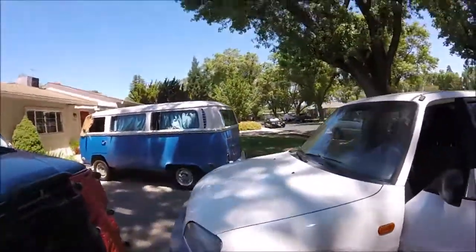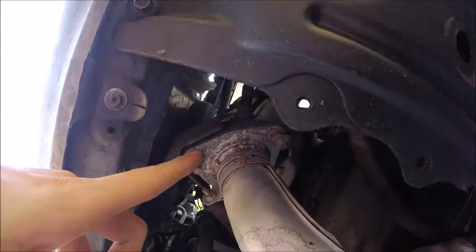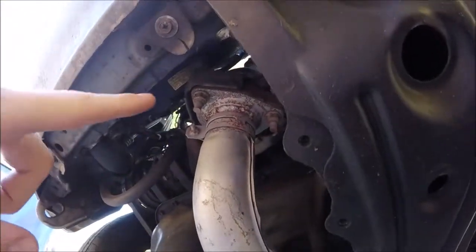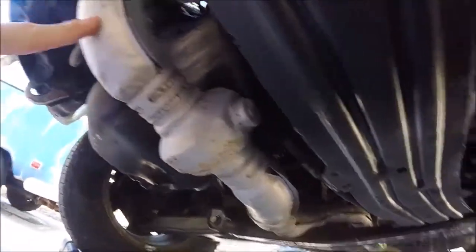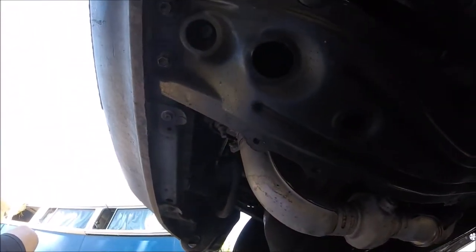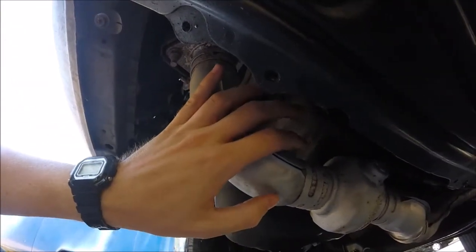Now this problem on this car you can kind of hear it. Here's the exhaust system on this car — here's the downpipe coming off the exhaust manifold and it just goes into the rest of the muffler system. I'm pretty sure I've pinpointed the leak to be coming either from this gasket, this gasket, and there's one more gasket down there. I've had this apart a couple times and also ended up replacing the catalytic converter, so I'm pretty sure the guys at the shop didn't end up putting new gaskets in the exhaust pipe. If you're not sure where your exhaust leak is, go ahead and inspect all the piping — look for any rusted out hole spots, or you can actually feel the air coming out of the hole.